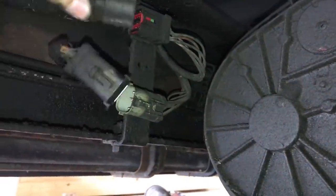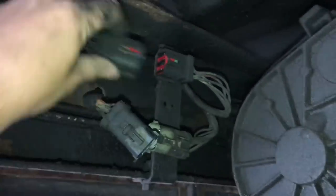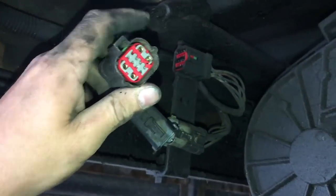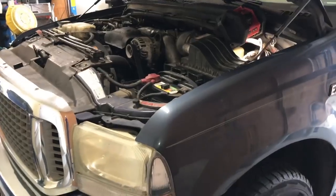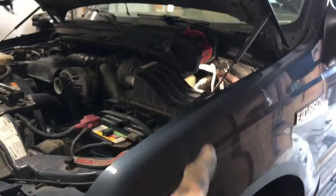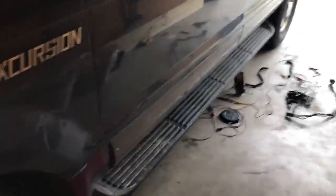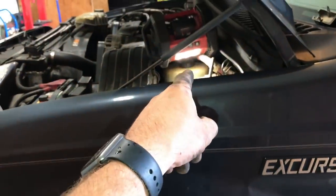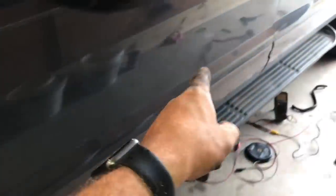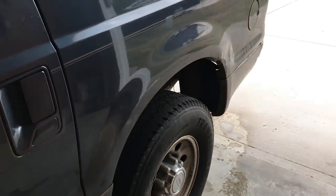I found these two connectors right next to the transfer case on the four-wheel drive models. The top one is for your trailer brake lighting. I unplugged the connector and continued my continuity tests. I found continuity — a good circuit — between the relay block and the connector in the middle of the truck. That tells me the wiring from the relay block to that mid-truck connector is good, so I could isolate that part out and focus on the wiring going back toward the rear of the truck.